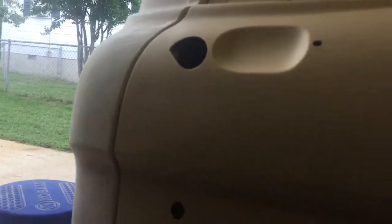I actually do have a fairly good gap, but it's weird, when I blocked this out with the filler, I didn't have this, but now I've got this line when I put the sandable primer on there, and I've got a tiny little ding right here now. Didn't see that before, and I thought I'd sanded that down, but anyway, this actually is kind of right where I want it, and that one is about where I want it.